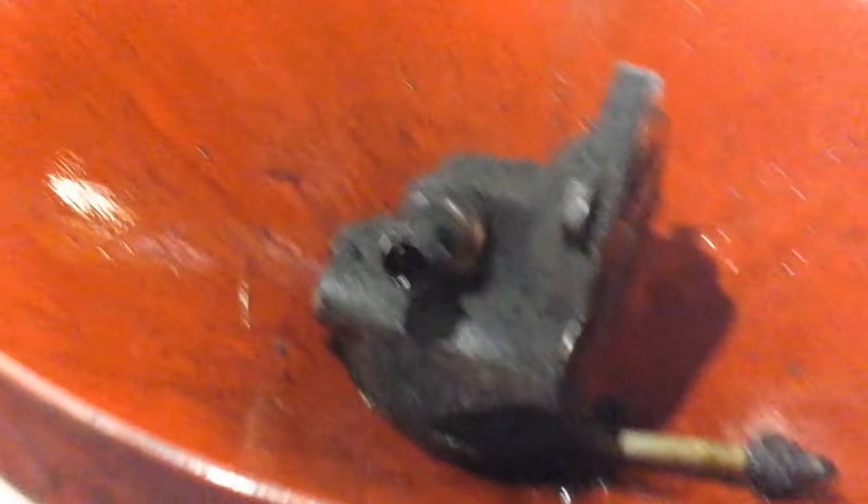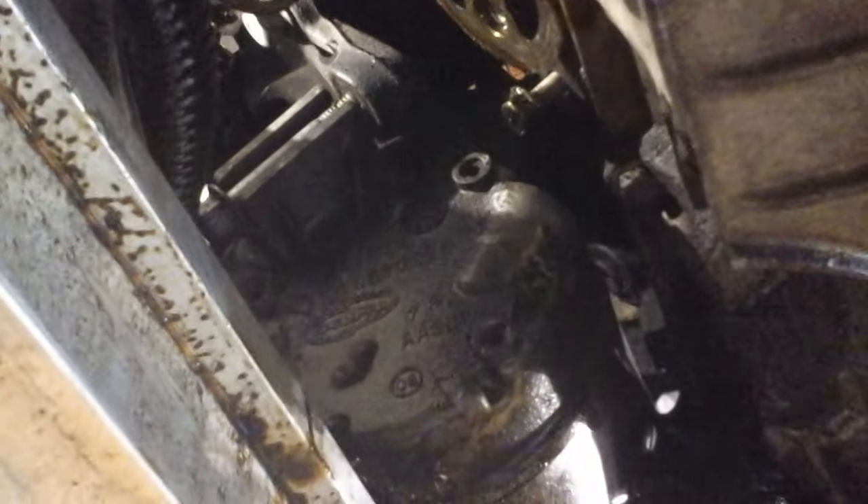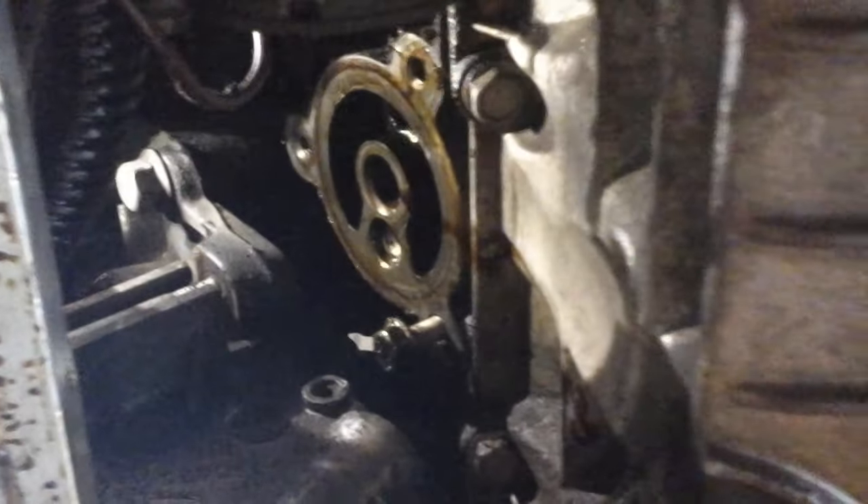There's the oil filter adapter, there's the gasket. Up here to make it easier, I took off three little bolts and pried that front shield forward and just blocked some wood in there to give myself a little more room to work. That took 30 seconds. Back here, that's the back of the compressor — there's the third bolt that holds the compressor. Notice it is not out; I just took it back maybe three turns to give some wiggle room. That's where the oil filter adapter goes.